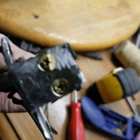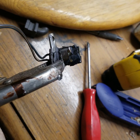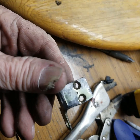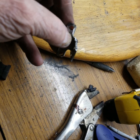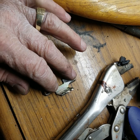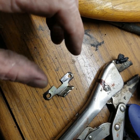When you get through all the plastic on the back, you'll find a couple of Phillips screws that you can back out — it'll help get the magnet out. There's a magnet and a coil of copper wire on this side. I've got most of it gone but the magnet is still there, so I'm just going to unscrew it and see if I can pop it out. When you're done, you get the magnet and the coil wire off and you're just left with this bracket here which bolts inside the crankcase. I'm going to use a mold I already made of this before I tore it apart, and use this inside the mold just to have something to mount to. On this side will be my transistor and stuff — I'm just going to pot the whole thing in epoxy.